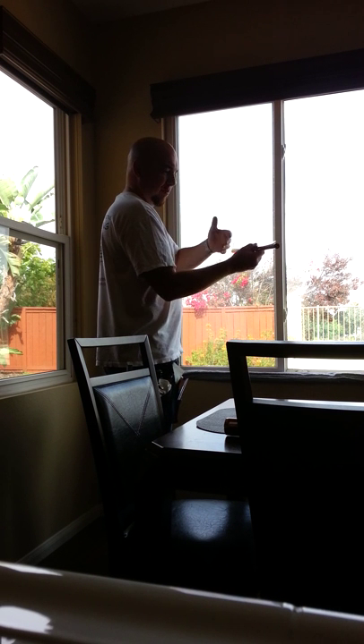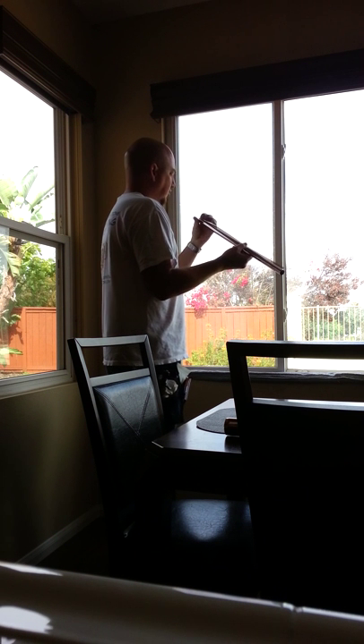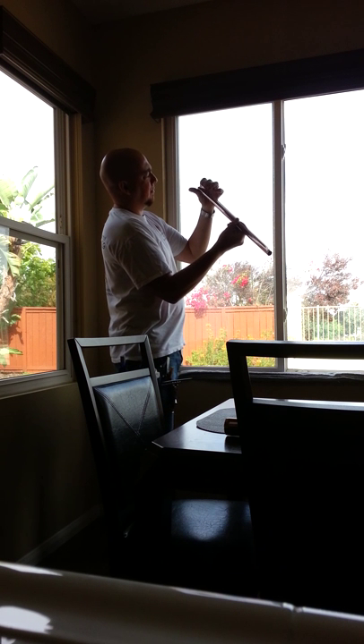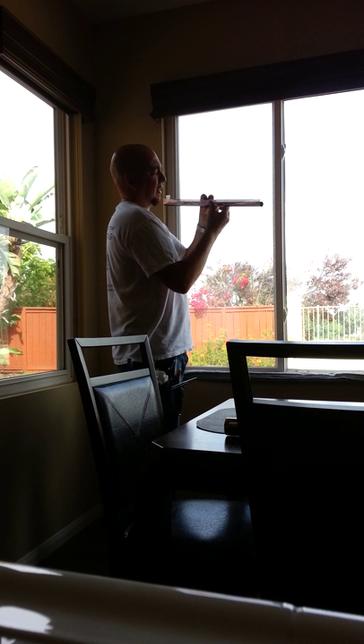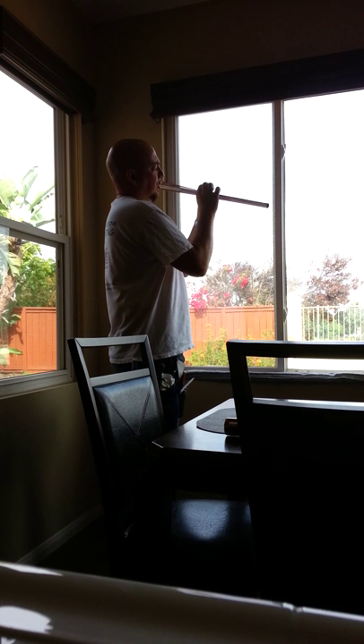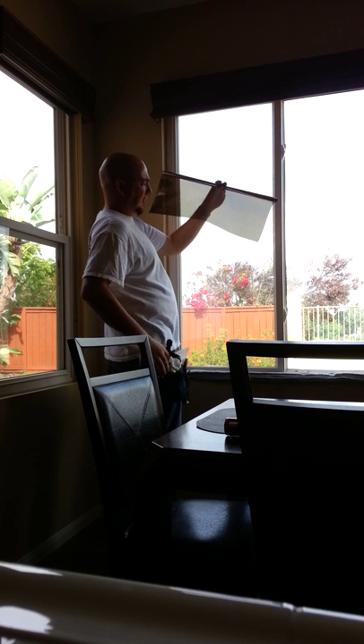So you want to give the film a little spritz. This lets the mylar stick to the film a little bit and therefore makes it easier to control. What I'm doing right now is opening up the surface in between the film and the mylar to separate it out in order to expose the adhesive surface to the glass.